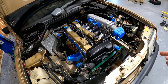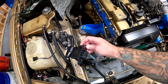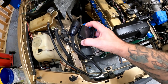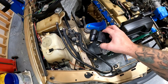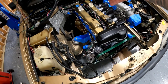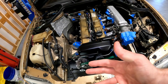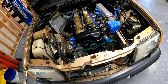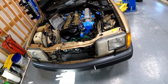I'm going with a recirculating blow-off valve. I'll have the BOV pre-throttle and it'll recirculate back behind the MAF sensor. Because this ECU uses a MAF sensor, if you run a vent-to-atmosphere BOV with an old-school ECU like this, once the turbo vents, the sensor has already accounted for all that air that went into the intake. You're causing a super-rich condition because the ECU doesn't know you dumped all that air and it's still putting fuel in for it. What you'll notice on cars with a vent-to-atmosphere BOV and MAF that hasn't been accounted for is that once you shift out of a hard boost pull, the car will try to stall.